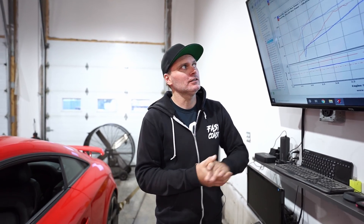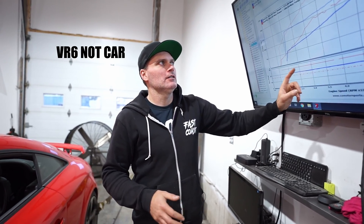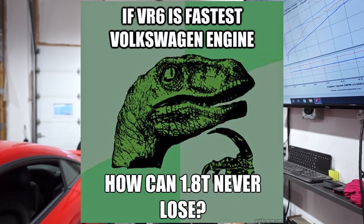The horsepower and torque of the 180 never fall below what the VR does from 2200-2300 RPM all the way to the end of the rev range — it's always making more power. Yes the VR is torquey and you feel that, but you're already further ahead in the power department with the 180. The reason we started this video is because it's definitely a misconception that the VR has more low-end power. Maybe below 1500 RPM, but after 2300 RPM the 180 shows large gaps in horsepower and torque.